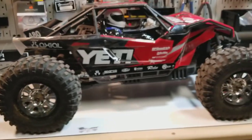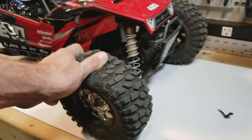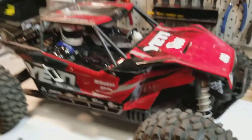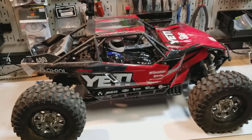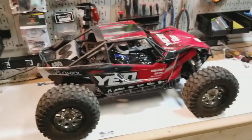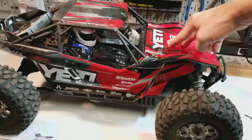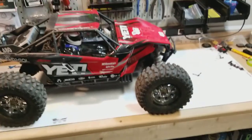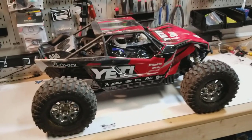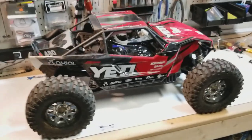The tires are performing well. I haven't taken this through much water or mud, but for relatively loose surfaces they did pretty good. They handled the moderate air I put it through just fine, and handled the little whoop-de-whoops at the BMX track just fine. The suspension definitely needs a little bit of work for the type of terrain I drive it in — I'm not doing trophy truck huge long jumps. When you jump this, the front is so well dampened and the rear is so springy that you go up the jump and it pretty much immediately nosedives, so you're constantly using throttle to try and keep it up. Suspension is definitely going to get some work — different springs or heavier fluid in the back, I'll figure it out.